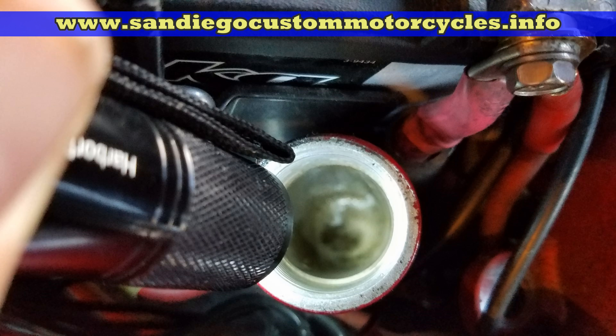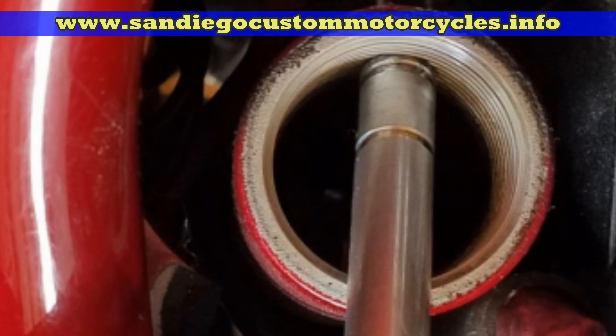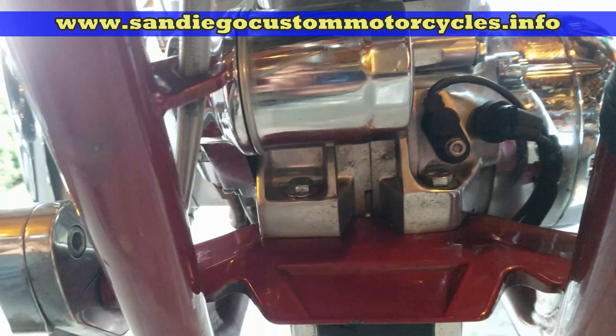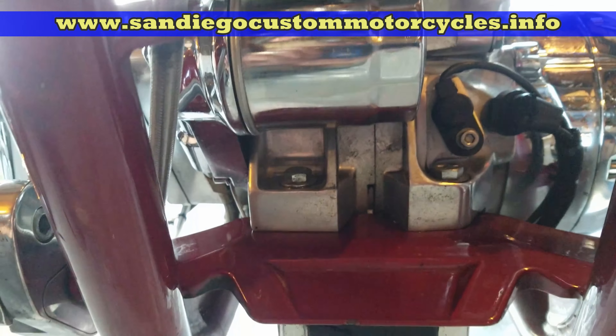On the K9, check your manual — you should just see the oil level like in the diagram when you look down that tube. You don't want the oil coming way up the tube. If you have a dipstick, you'll see two marks and obviously want to get it somewhere in between. Check that after you refill the oil and after you take it for a short ride.